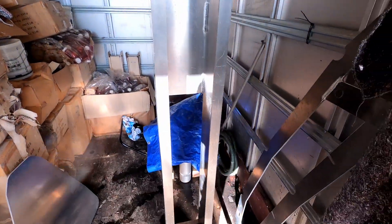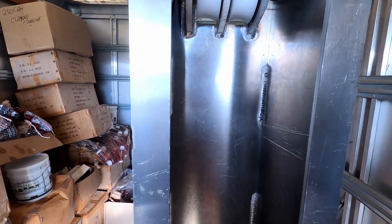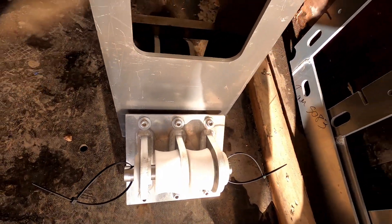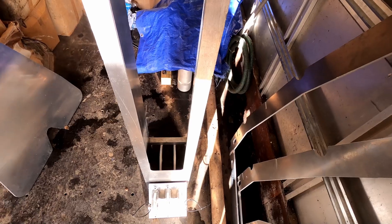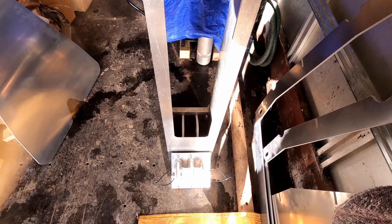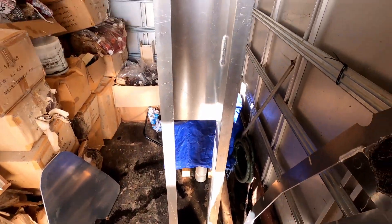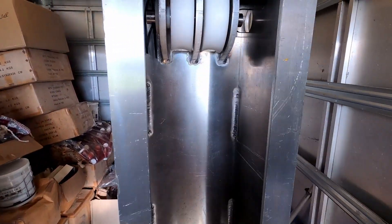In the mast column support you also have these Delrin wheels, so you will have two spectra ropes going down here, and then another one — these parts will help towards raising and lowering the swing keel. There will be a little crank on the side where you can crank it up and crank it down. You can have a pneumatic or even an electric solution for this, but I've opted for a solution where I have fewer moving parts that can go wrong, so by just having a crank and some ropes I expect it to be fairly straightforward to fix if anything breaks.